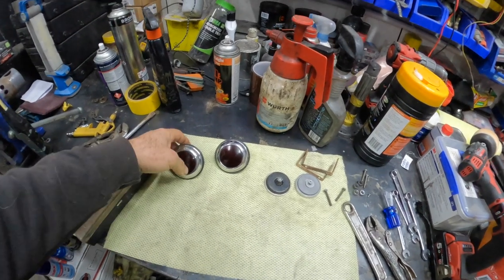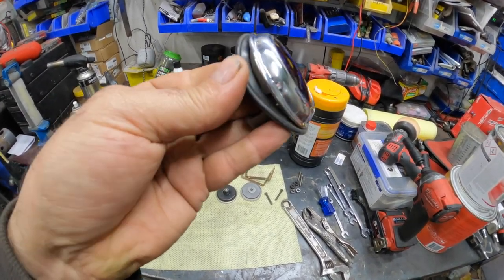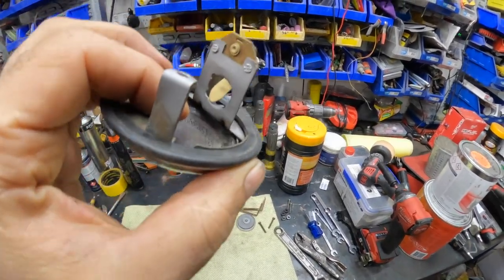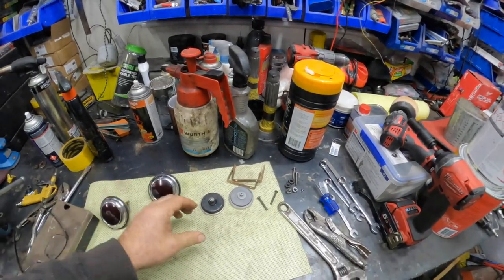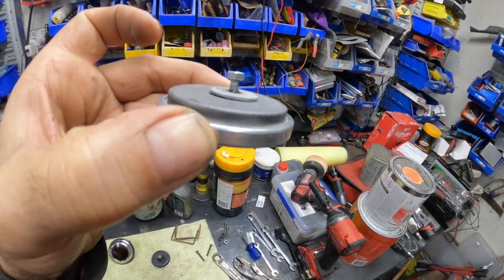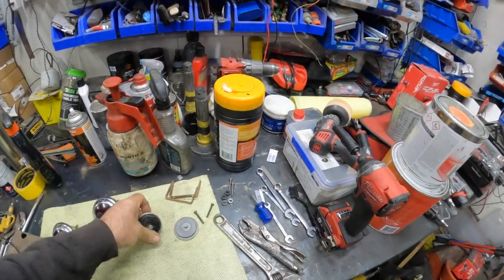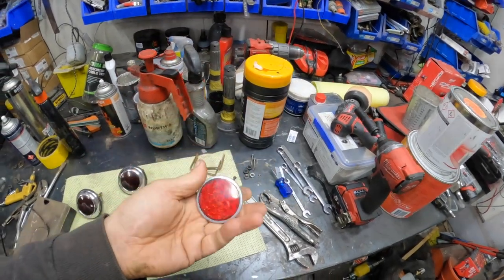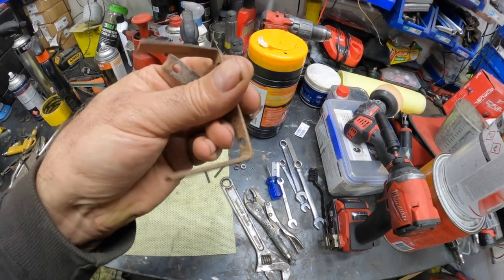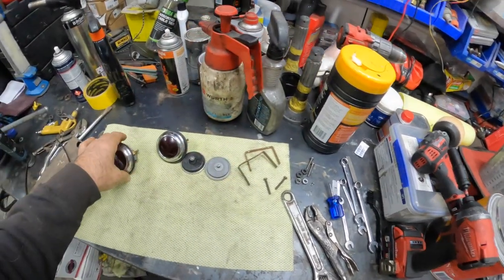After a little bit of polishing, you can see this has come up a lot nicer. I just put it over the buffer with some metal polish. I've also got the rubber gasket behind it, and I just used some glass beads to go over the contact areas — at least this is nice now. As for the reflector that was damaged, I ended up drilling and tapping it and then putting a little bolt back on it, so that's how it's supposed to be. I polished up the edge of it and we just need to paint this backside black now to match the other one. These ones must have been plated — they've got a copper covering on them. I just blasted all the rust off those, so they'll be good enough.